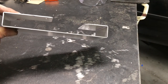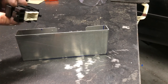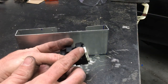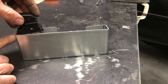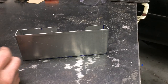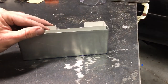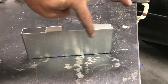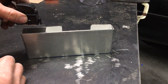Here's the initial skeleton part of the handle I'm making. The purpose of this is to hold the single window switch. This switch doesn't give me very many mounting options, however it does have a little push tab here and a push tab there, which I intend to use. This will get pushed in and I'm going to make a relief on this side for the push tab to pop out. We need something to capture this switch, which is the second inner piece we're going to make, recessing in here. We'll have a through bolt on either side, and I'm probably going to run some rivets through here with dimple dies so everything matches.